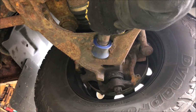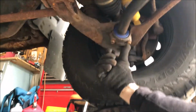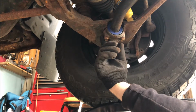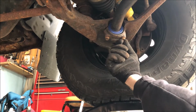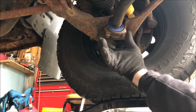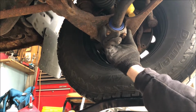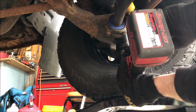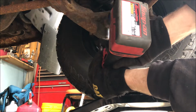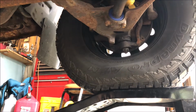And now I can start the cap. Again, 13 millimeter for the bolts. Now the caps don't seem to have any wording other than the part number. They don't look directional, no arrows or anything. So I just reinstall the caps, and then I'm gonna zip them down. Don't overdo it if you're using power tools like this. They just have to be snug. Once this cap bottoms out, and you can feel the bolt bottom out by hand, I just give it just a little bit more. You don't want to snap these off because they thread into the A-arm. That's plenty, and same on the other side.